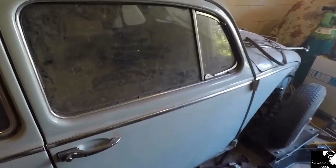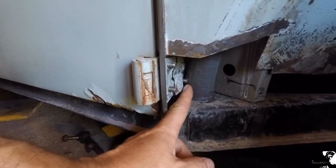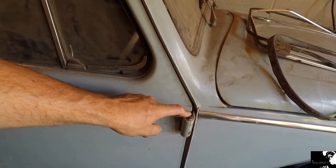There's still a lot of adjustment to be done on this door before I can move to the next stage. It's still binding on the catch. I've also noticed that with the hinge adjustment, one of the screws — the furthest screw inside — is actually hitting upon that heater tube there, so I'm going to have to reduce the length of that. Also the door pins: I'm getting a lot of drop on the door due to the saginess of these door pins.